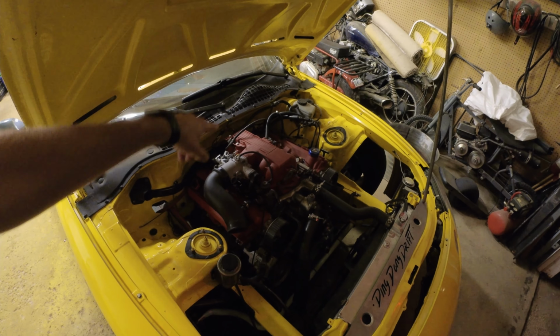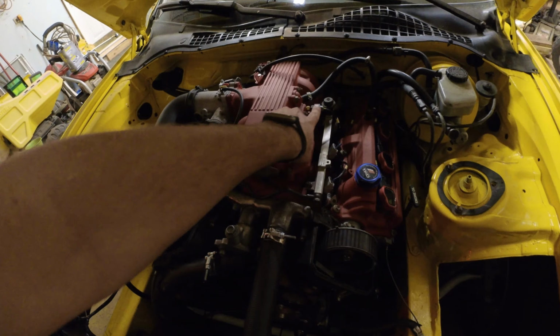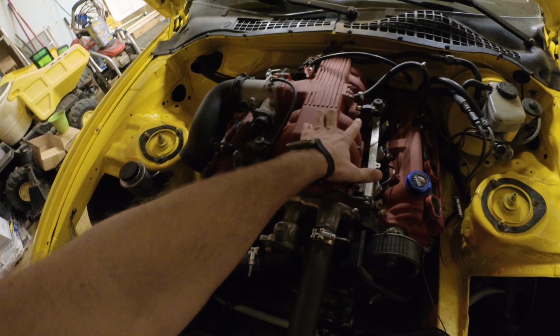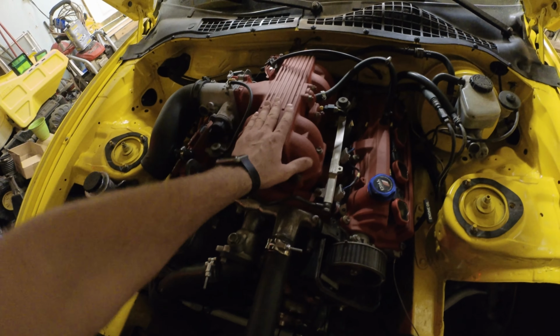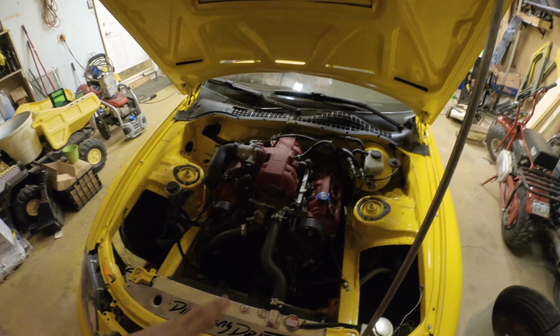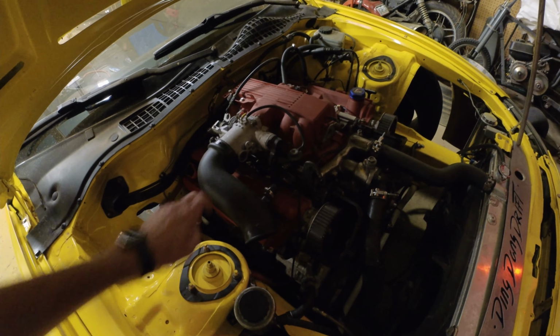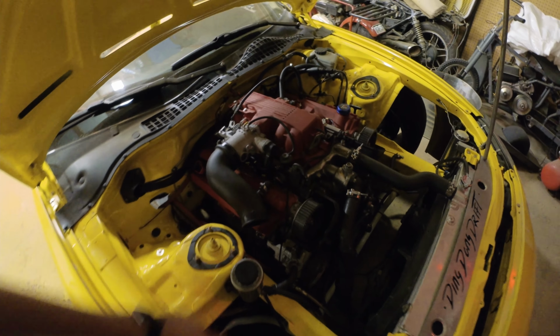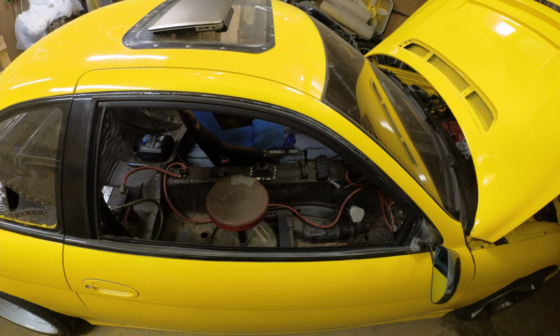Intake air temps were rising a bunch, and I need to move the intake air sensor somewhere away from the engine because it's really heat soaking, which isn't that big of a problem, but it does kind of suck. So when I make an actual aluminum pipe or whatever I do, I will mount the intake air sensor on it. That will be a lot better. It won't heat soak as much. Everything's good. Everything works on it.